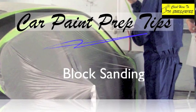Well, that's defeating the whole purpose of guide coat. If you're going to tilt the block to sand it out, you're basically sanding that low area or scratch. It's going to be low where you sanded it. So if the guide coat stays there, that's good. It's doing its job. And sometimes you can sand till it sands out, but if you start sanding through the primer, you need to stop. It's going to have to be primed again to fill that area.